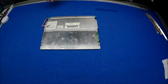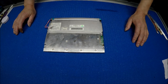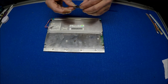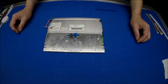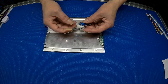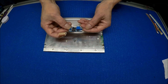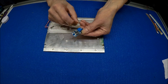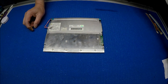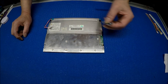This inverter, if you look at the data sheet, is using a 5-volt supply inverter. If that's a 5-volt supply inverter, then you need an additional part called MS57APW. You get 5-volt from your existing inverter wire harness on this side, and then the output is 12-volt. There's a part you can adjust the voltage. This is probably $10 that we sell. Before you order the LED kit, please double check the supply voltage. If it's 5-volt, then you need an additional DC to DC converter.